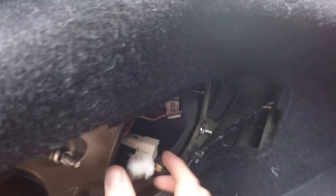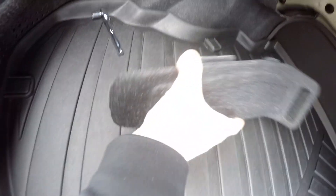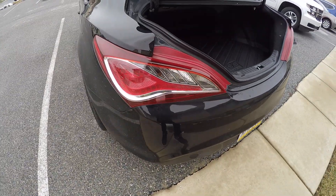After all of them are down, go ahead and plug your connector back in — that would be for the LED lights. Then take your insert; like I said, stick the bottom one in first, then tackle the two top ones. Bend it in a little bit, push the bottom one up to bend it, push it in, and there you go. Make sure that's all there and that's it — you've got the tail light back in.